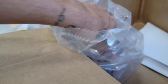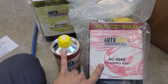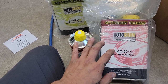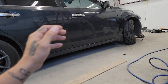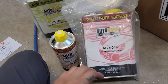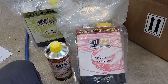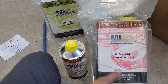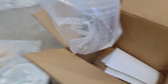The Glamour Clear doesn't take a lot of work afterwards. It mixes on a four-to-one: four parts clear, one part activator. I chose medium speed for the activator as well. Total, you get five quarts of sprayable clear. They also have their Euro Clear - once mixed, you get about four quarts of sprayable clear, but that finish you'll have to sand and polish afterwards. That's why I prefer this one - right off the gun you get a nice flat, really glossy surface. You can add about five percent reducer but you don't really need it.